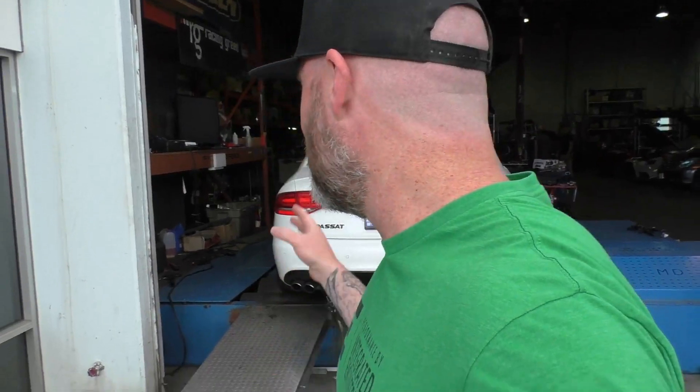458 wheel horsepower and 407 foot-pounds of torque are the final numbers today here at RacingGreed — Stage 2, dual pulley, E40, throttle body upgrade. I was hoping for more power from this upgrade — I was thinking at least 10 wheel horsepower — but I'm glad it made something and I'm happy to prove it actually does make power. I'm bringing you guys real results, nothing fudged, nothing changed. I'm fully transparent with you guys on all these videos so you know how well or how poorly parts work.